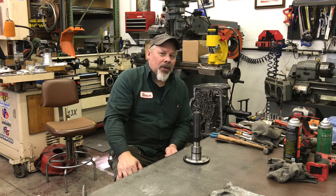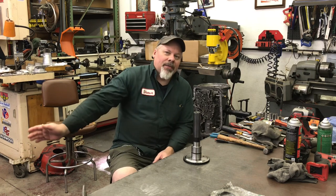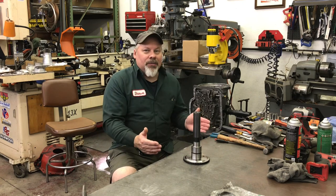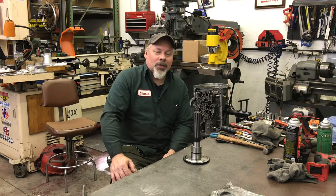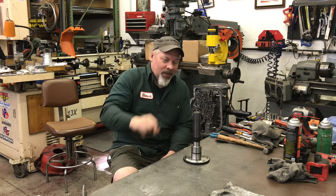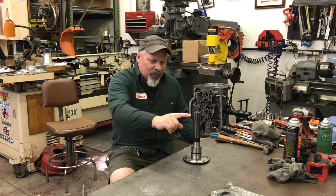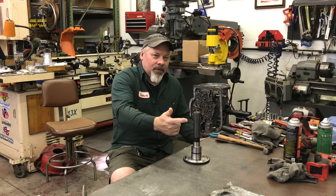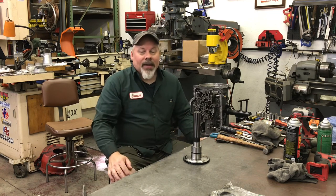The shorty turbo 400 isn't very popular, and I'd caution against it for drive-and-drag events or drag week type stuff where you have an unusual combination. Everybody has a short shaft 400 — if yours is shorter, good luck. But that's what that scribe line is for. To clarify: the 205 uses a two-wheel drive output shaft, and the scribe line is to make it power glide length.